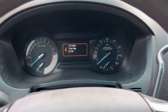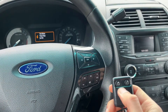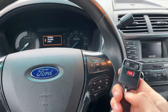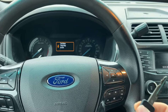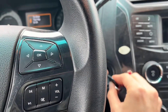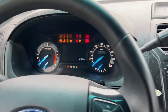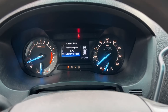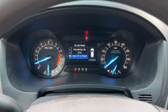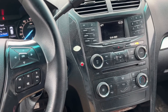The second thing I want to mention is about taking control of your vehicle. The instrument cluster says to turn the key to on. Note that if you remote start your vehicle when you're inside like this, you need to then unlock the vehicle before you try to start it or take control — that disarms the security alarm. You might also notice that the instrument cluster does not immediately display that the vehicle is running, but the vehicle is running. You just have to give it a second for the gauges to turn on and for the HVAC controls to resume normal operation.